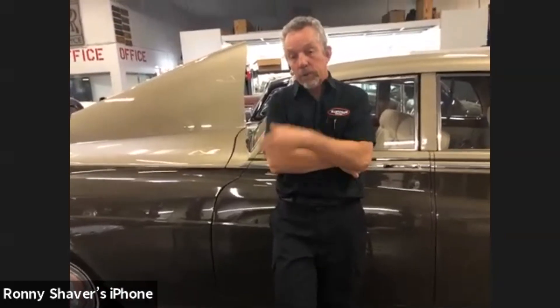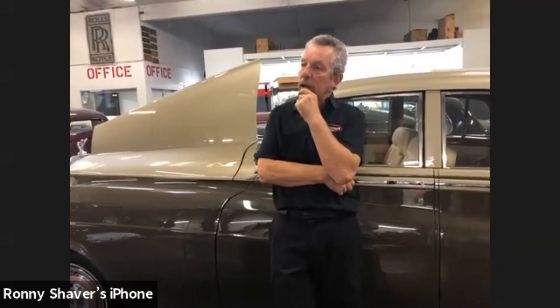Most top issues on the Corniche — and we're going to stick with the earlier Corniches, prior to '93 through '95, I think, '76 and '83 — they don't typically have too many electrical issues. They will have hydraulic issues, what I have found mostly. Some of those years, the parking brake has to be applied for the circuitry to work. They have some relays. Most of the problems I've found with those tops is the pump will run, but it doesn't do anything. It has a couple of solenoids which are pretty bulletproof. Typically it's a loss of fluid issue — that's what I've found.